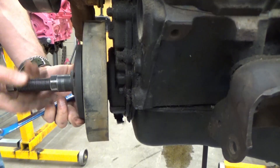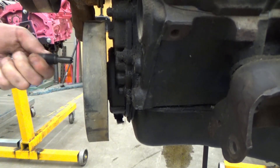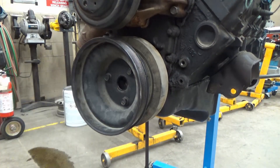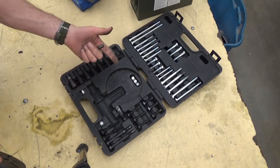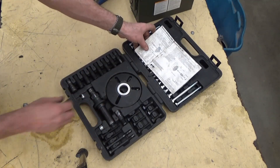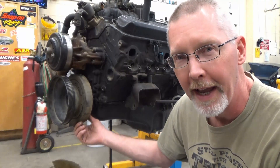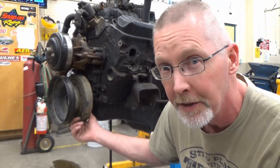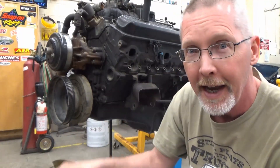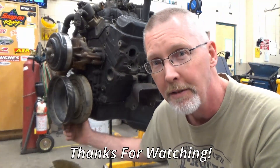Please, for the love of mercy, put everything back in the kit — the bolts, the washers, the adapter, the plate, and the instructions — so the next person can figure out how it works, or I guess they'd be watching this video. Like, share, subscribe. So that's the basics on how to install and remove a harmonic balancer: different pullers for different balancers, always pull from the inside not the outside, use the right thread, and put everything back in the kit. Thanks for watching, take care, and we'll see you again.